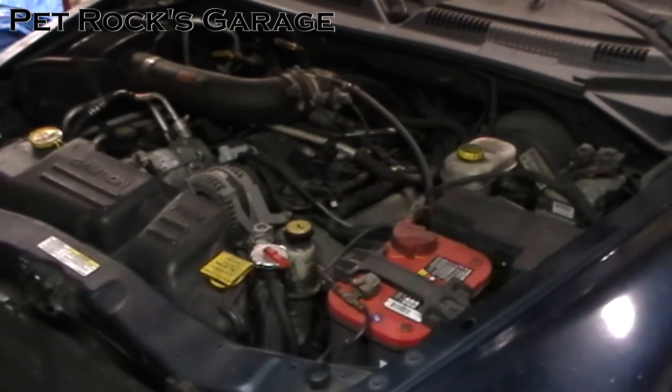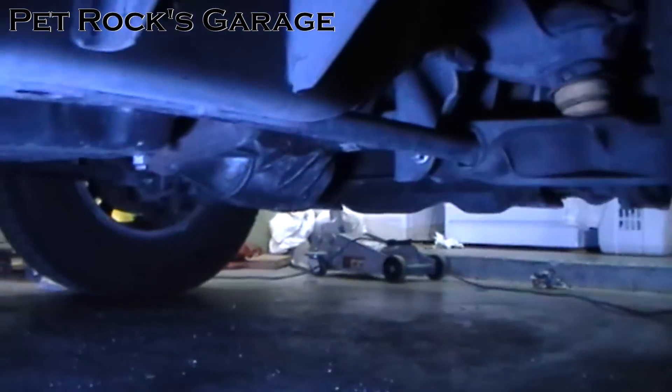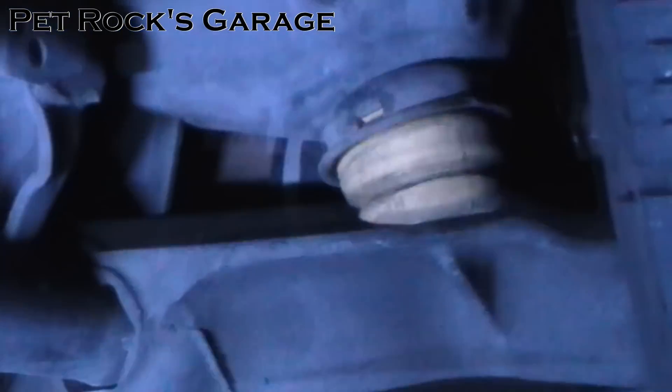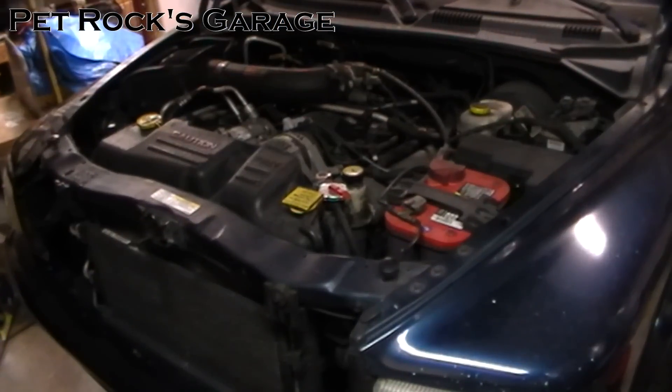The first thing you want to do is put your truck on a level surface. You don't need to raise the hood. You want it firmly on the ground with the suspension holding up the weight of the vehicle. You don't want it up on jack stands or jacked up at all — you want it at its normal ride height. My truck is on level ground right now and yet the lower bump stop is pretty much straight up against the lower control arm, which shouldn't happen. There should be a nice air gap between those two. Once you've got it on a level surface, bounce the suspension a little bit to let it settle.